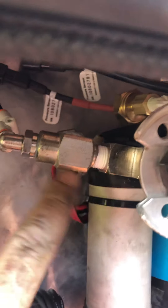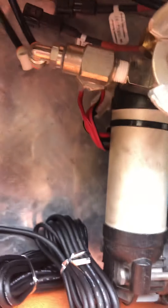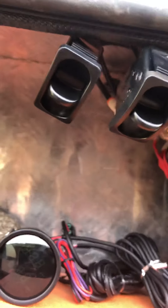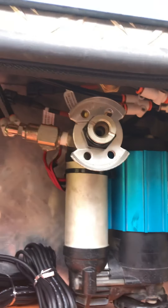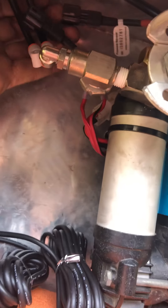Air compressor there, outlet line - I've reconfigured it, put a T-piece in. I've got the overpressure sensor there from the ARB, and a T-piece up the back that runs into these two switches up front. I've removed the wires from them as I mentioned previously - they're redundant because I'm using the onboard ARB compressor. I've got the inlet from the bulkhead fittings, a couple of wires run to the switches, and a wire fitting off the outlet side of the compressor to the switches.